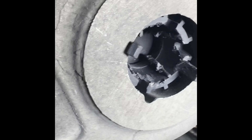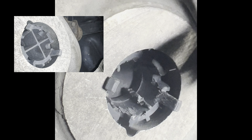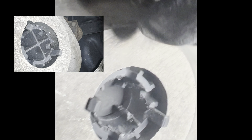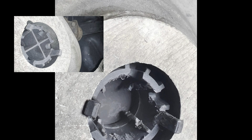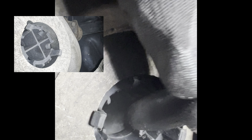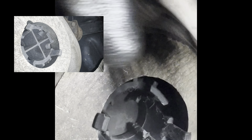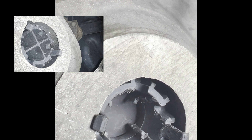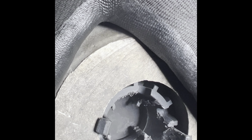The first step is to get rid of this plastic tee right here — just use some pliers and cut through it. Then you'll see the rubber, and you're going to drill a little hole there. The bag is going to sit inside the spring and the air line is going to come out through that hole. I'm not taking the springs off — you can do this with the springs off, but I'm not doing that.